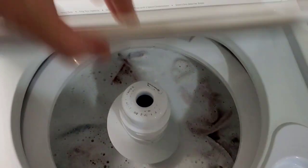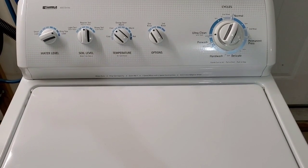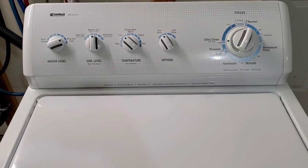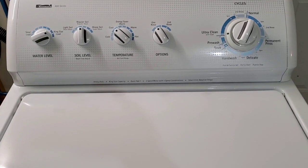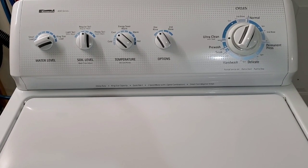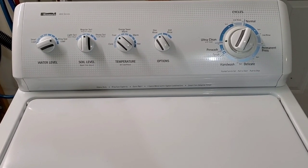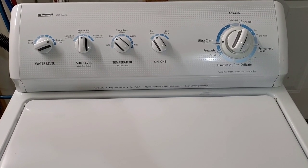Something good to check — if you can reach in your washer and spin this freely in both directions, then it's not working, it's actually broken. Sometimes your clothes aren't getting clean and people have no idea. But if you listen, you can hear what I call the agitation kick. It's pretty quiet, but you want to hear that on a top-load washing machine. If you don't, then your clothes aren't getting clean. Good tip.